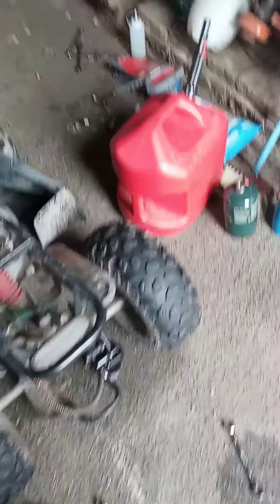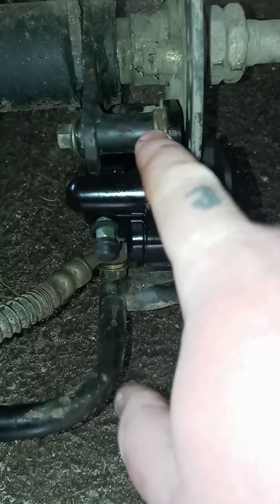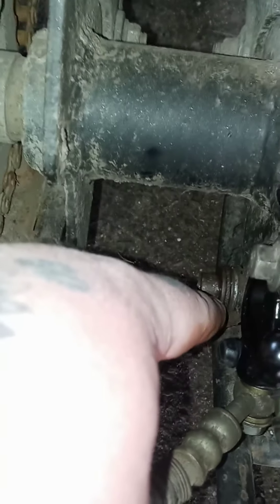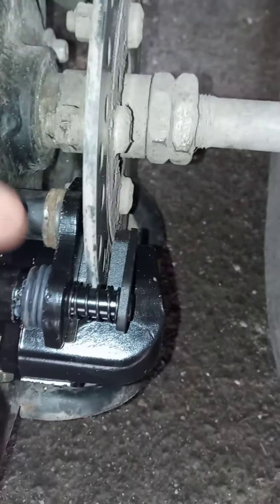I got the caliper back on. This one went in perfectly — the washers are right here. The second one I kind of had to put them here; it was really hard to get through there underneath or anywhere, but that should just stop the bolt from going all the way in and hitting this rotor here. It's all on, the brake line's all tight.